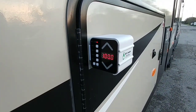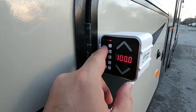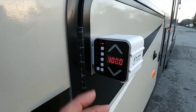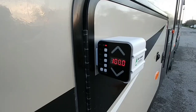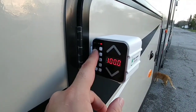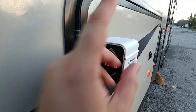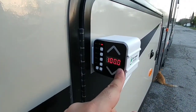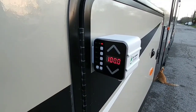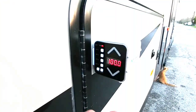When you have an arrow and you're trying to get set up left to right for side-to-side leveling, it's telling you which side of the trailer needs to be lifted or lowered to be level. If you have an arrow pointing up during your side-to-side measurement, that means you need to put blocks on the driver's side because you need to raise that side of the trailer. If the arrow points down, you need to put blocks on the passenger side to raise that side of the trailer.